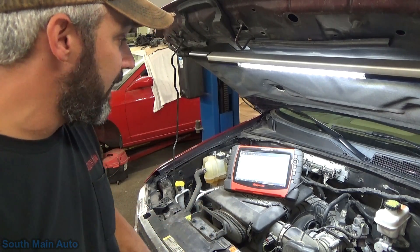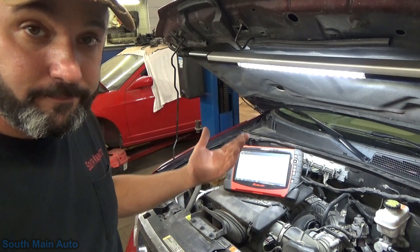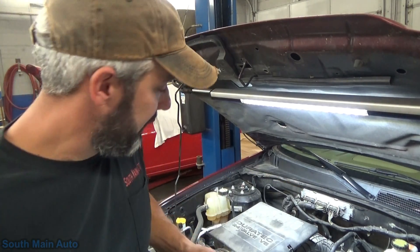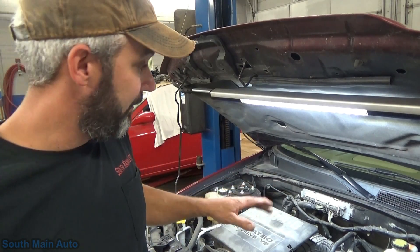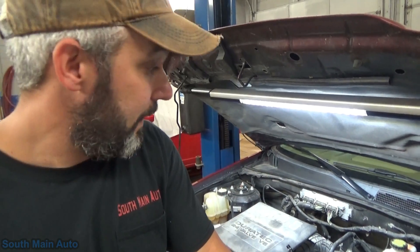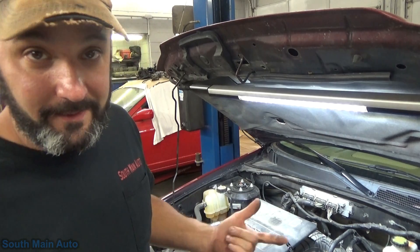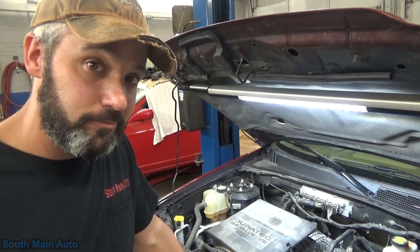I'm actually running it through a small leak test right now with the scan tool using bi-directional control. The test takes a little while. I don't think it's going to allow us to complete it, but we did get to see what's happening. I wasn't able to run a complete small leak test — it was unable to achieve the required engine RPM — but I'm confident about our repair. Running a drive cycle to get the monitors to set the small leak on these can take days, or depending on ambient temperature, weeks or even over a month for the key-off portion. So we'll leave it at that. I hope you guys enjoyed this quick tip. Find us on our socials, put questions and comments in the comment box below. If I can do it, you can do it. Thanks for watching.